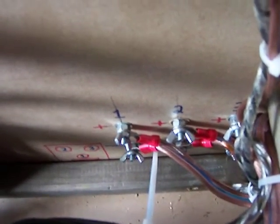But let's see. Like you said, I got the wires. You can see them. Power wires, remote, all that. Got the RCAs going in. All the wires for the subs right there. About as clean as I could get it with the wire, what it was. I didn't have any 12 gauge of that. I'm gonna look at trying to get some 12 gauge and seeing if I can bundle up a little bit better. I don't know how much I'm gonna need of that, but I might pick up some of that for the subs. Again, with the hole, it's right there. Trying to keep it as clean as possible. I think I did a pretty good job at keeping it clean.